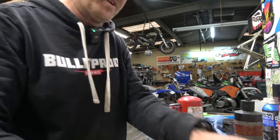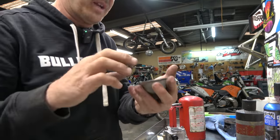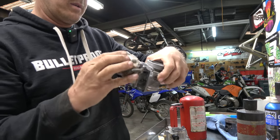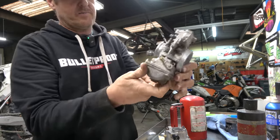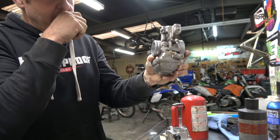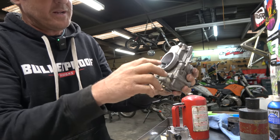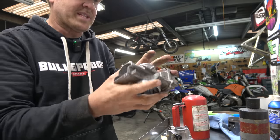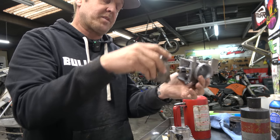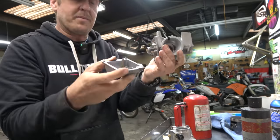Here's my Keihin that I like very much. In a normal carburetor you have this tube that sits up inside just below the level of the Venturi. When you splash, it dumps gas out through this overflow hole — there's a fuel line on it so it doesn't dump into the motor. That's the whole point of the overflow: to keep gas from going into the motor whether you lay the bike on its side, crash, whatever. It helps keep gas out of the motor.